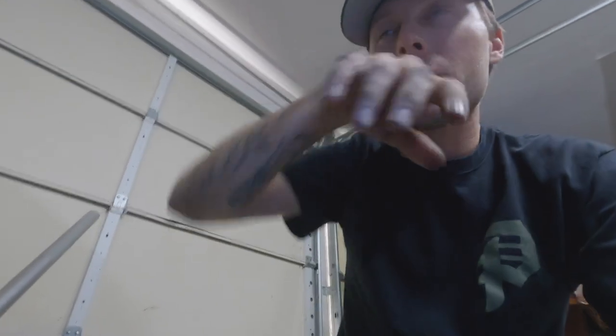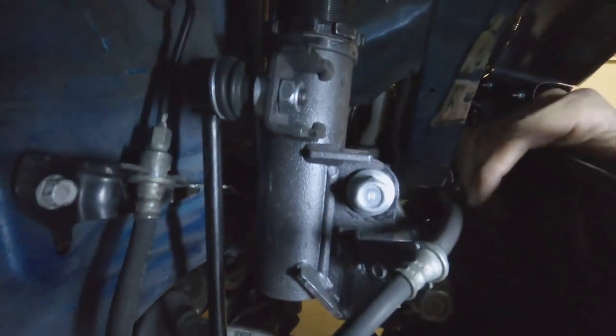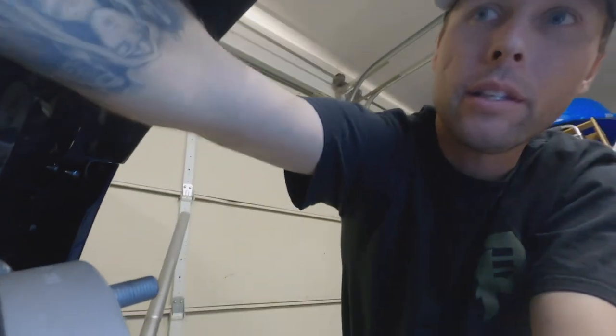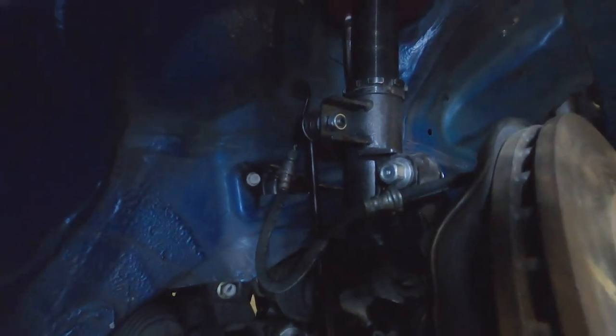So to be honest, it seems like with this spacer on the back and actually tightening down the sway bar link to test it, I think it honestly might be better. I ended up not hearing any noise and clunking, and it definitely clears, especially simulating with the jack, having it up to simulate weight or a load on the car, on the suspension, seems to be doing well. And the bracket's in there and everything, I know for sure when it turns to the left on this side, it's fine.